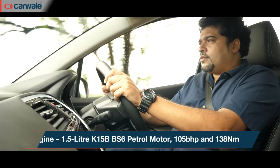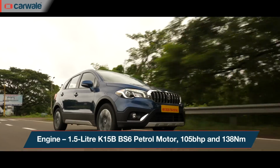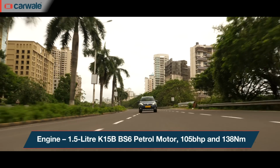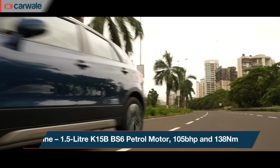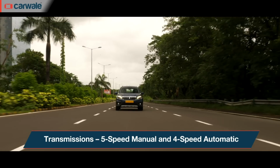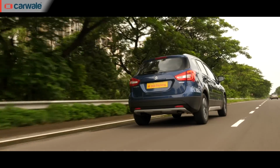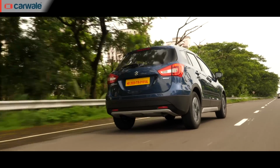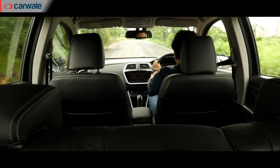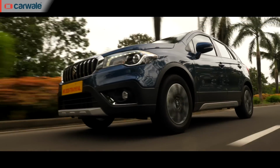What you get now is the 1.5 litre naturally aspirated petrol engine that also does duty in the Ciaz, Ertiga and the XL6. The K15B motor pushes out 105 bhp and 138 Nm of torque. The engine comes with a 5-speed manual gearbox, and for the first time the S Cross also gets a 4-speed automatic option. This is the 4-speed auto that we're driving now. While driving normally, the engine feels refined and the upshifts and downshifts are smooth. But step things up and the 4-speed torque converter starts to show its limitations. It's just too slow to respond and nowhere as quick as the other CVTs and the twin clutch automatics out there.